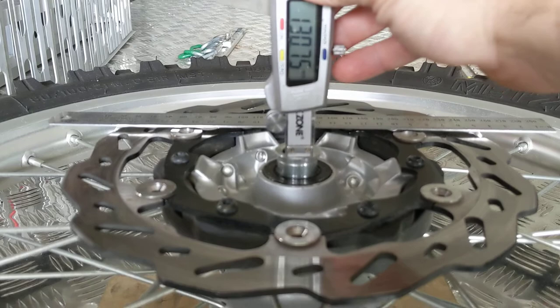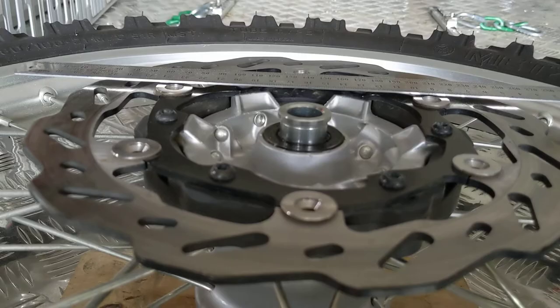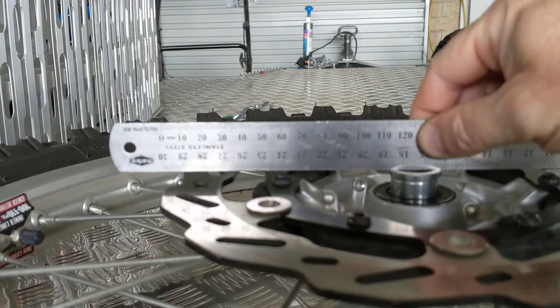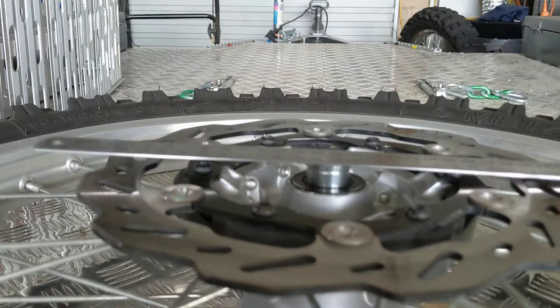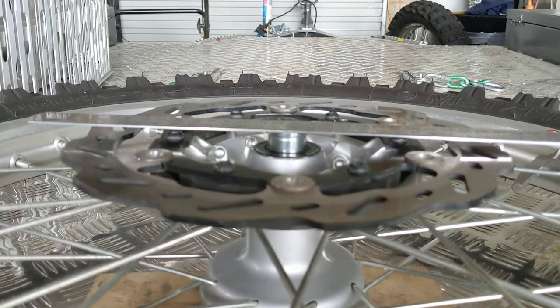To check the disc offset, set a metal ruler or straight edge and then measure from it down to the disc surface to get the actual disc offset from that spacer. I did that methodology on both wheels and just did the simple maths — that's how I ended up with my spacer dimensions. It's not terribly difficult, but if you're struggling with the concepts it's probably outside your technical ability. Take your time, measure everything twice, and it turns out pretty good.